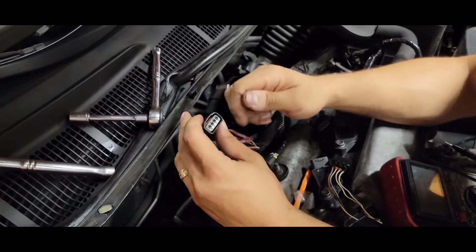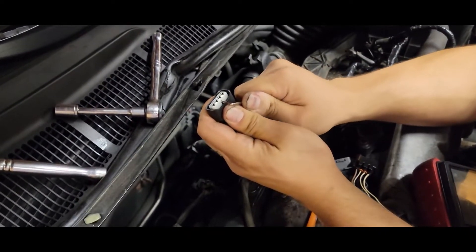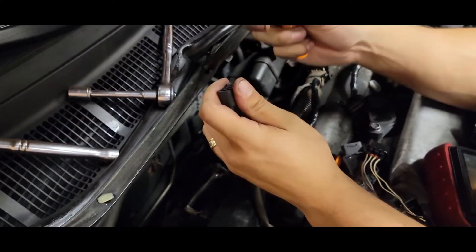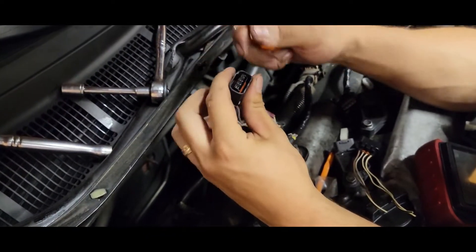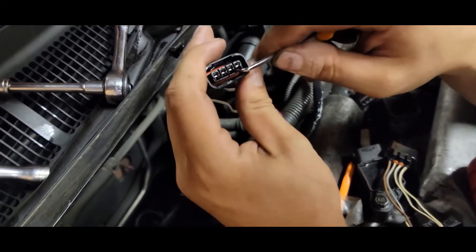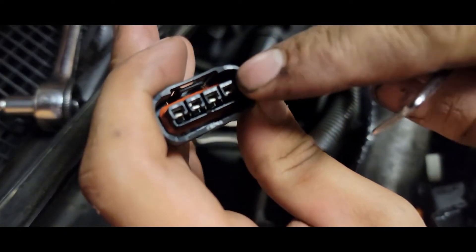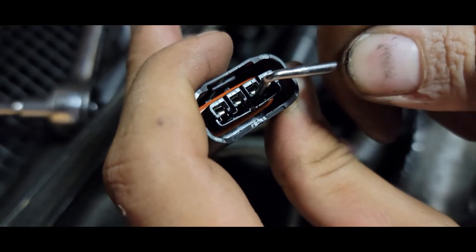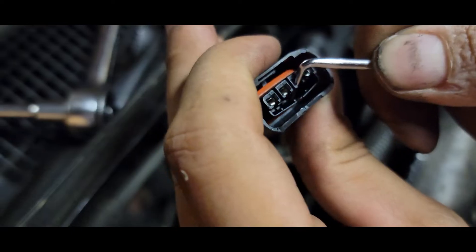I like to use these picks — they're cheap. They do have tools made for this, but this is basically all you do. You stick the pick underneath the connector. Don't stick yourself, but be real easy because you don't want to lose these in the engine bay — these are $50 connectors. These two are the wires that are switched up. Inside, if you look really close, there's a little clip in there. What you've got to do is push that clip down, and these picks actually help push the terminal back at the same time.